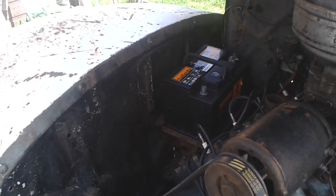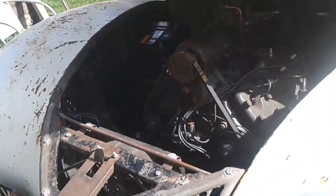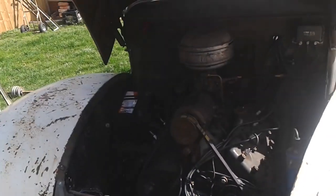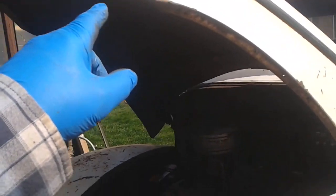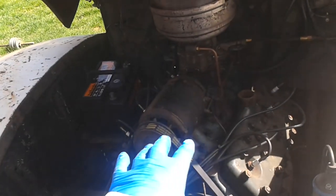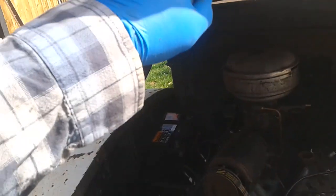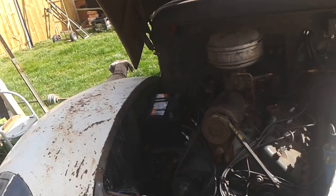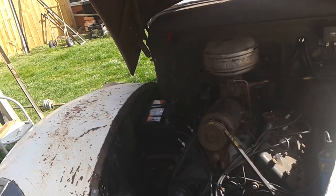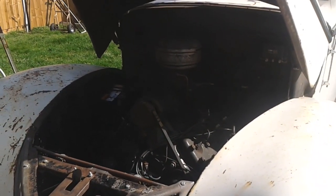The radiator is out, I drained all the coolant out, I've disconnected the battery. I think what I'm going to try and do is take it out with the hood in place, so I'll probably take off the inlet manifold so I can lift the engine really low down and pull it up and out. I'm going to try that - I don't fancy wrestling with the bonnet. Okay, back when there's more to show.